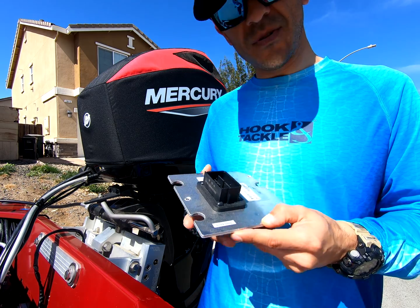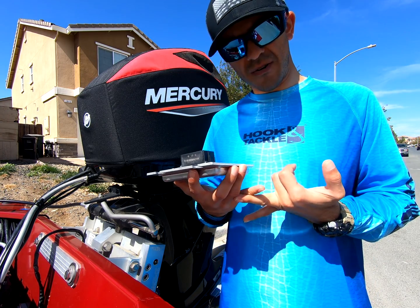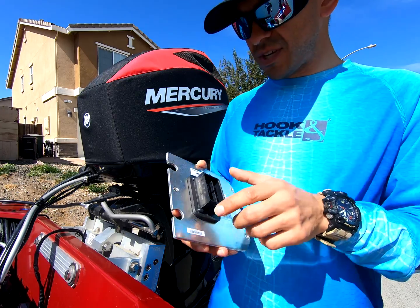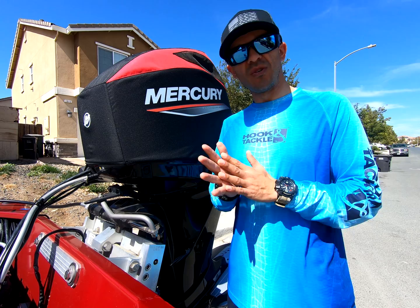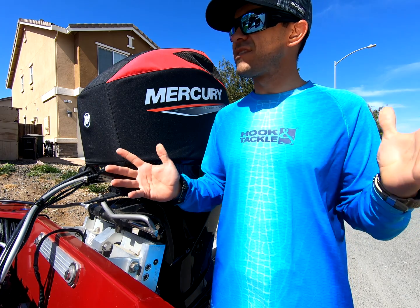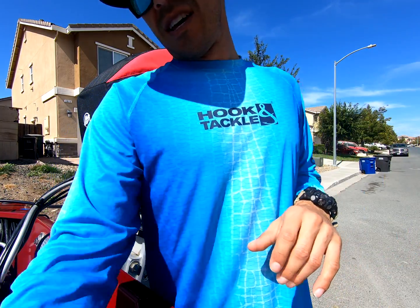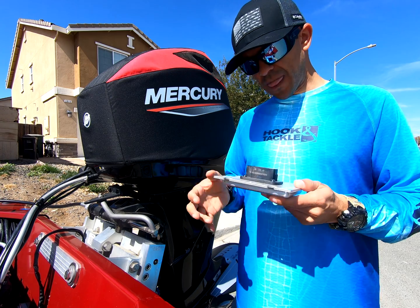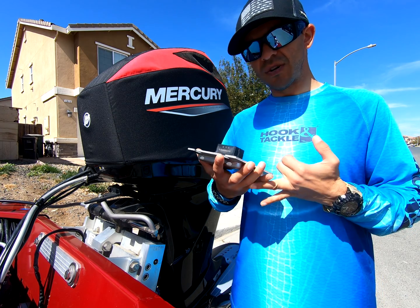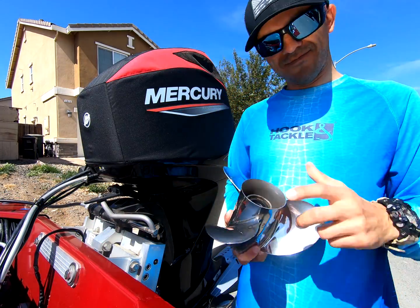After that, you have to replace your 40 or 50 horsepower computer with a 60 horsepower variant of the same ECU. They don't allow tuning anymore for the newer outboards — I think it's 2013 or 2014 and up. Mercury did some kind of cease and desist on all tuners, so you can no longer tune your computers to convert them into a 60. You've got to go straight to a 60 HP ECU, either new or used. I'd buy it used because then you don't have to go through the setup process at a Mercury dealer.